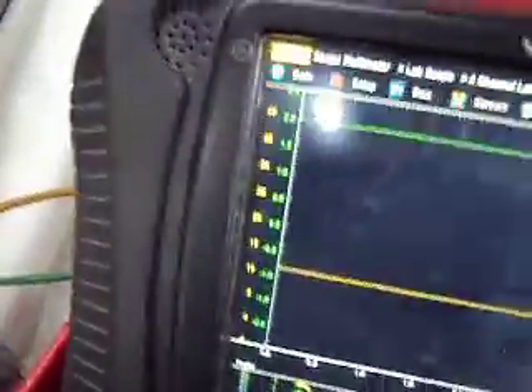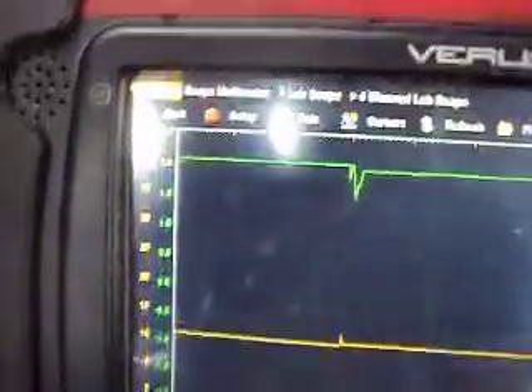It's stuck at one position. When I unhooked it for a second it did glitch a little bit — just a small glitch when I was opening and closing it. But not the one to four and a half volt range you should expect to see when grounding out the solenoid. So our valve is working and passageways are clear, but the position sensor in the EGR valve isn't good.